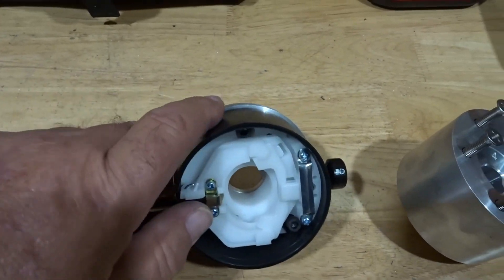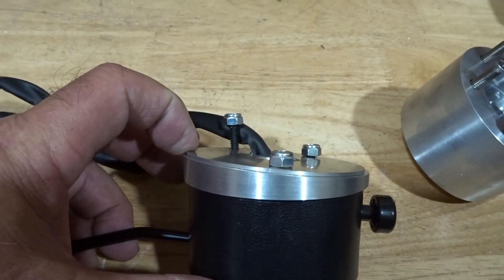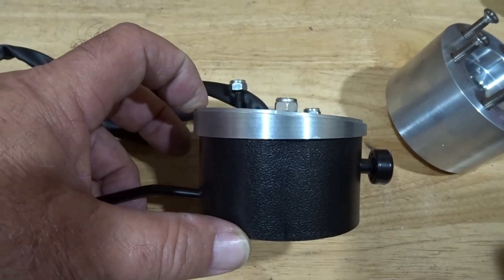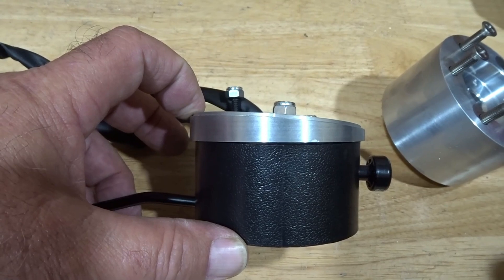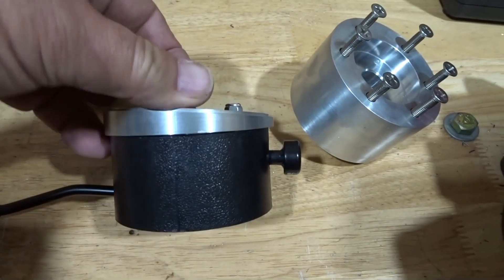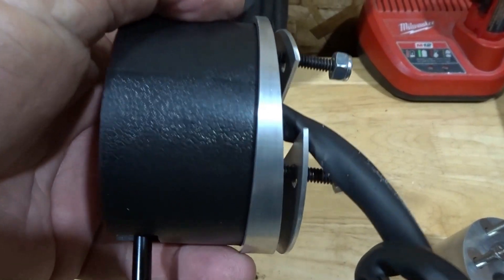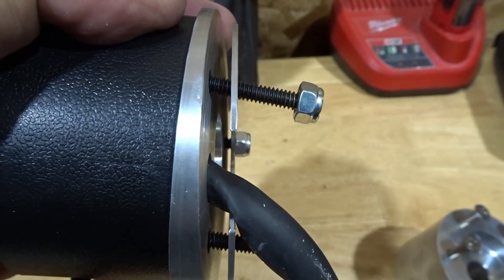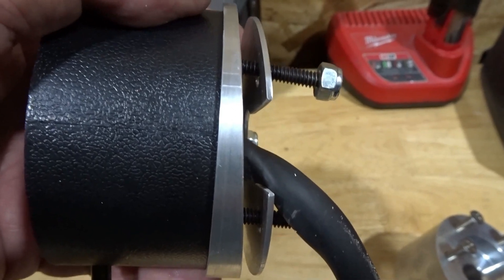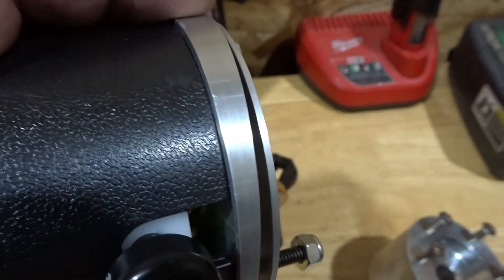You can see we've got the turn signal switch, and on the back we have an angled spacer. That angled spacer is what allows this to sit flush on your dash. This actually bolts to your dash, whether you have a carbon fiber dash, the padded plastic dash from Factory 5, a carbon dash from Factory 5, or your own fabricated dash. There's a backing plate on the back that sandwiches everything together. We've provided screws lately that are a little longer than the ones with the first few kits, since some padded dash guys were having issues with the hardware not being long enough.